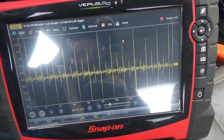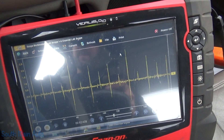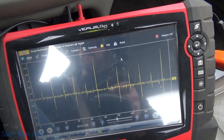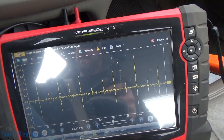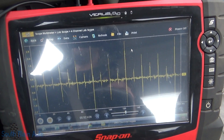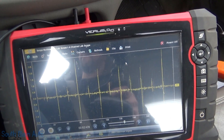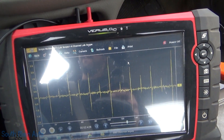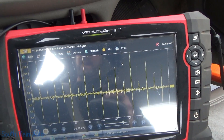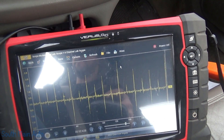What do you think that is? It looks like a very repeatable, repetitious event — and it looks like that of a waste spark system. I believe those are the firing lines on our ignition wires. You'll understand this a whole lot more when you pop the hood. It's been — I don't know how to say it nicely — touched. I popped the hood and I almost backed straight outside because the thing is a nightmare.